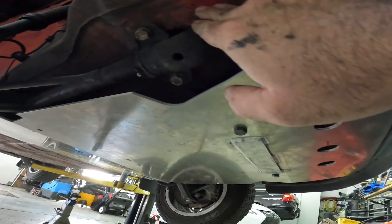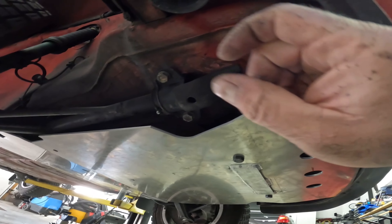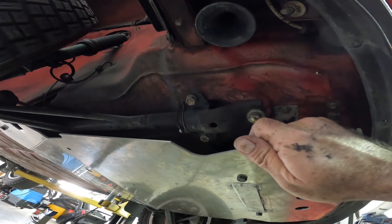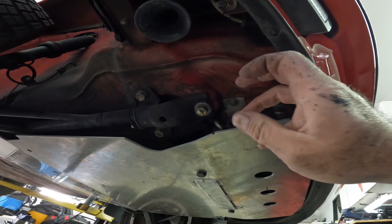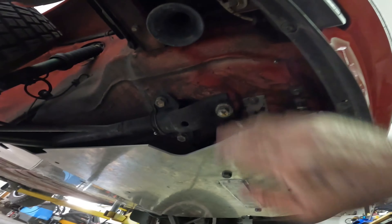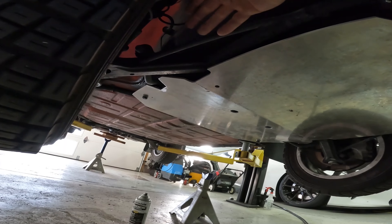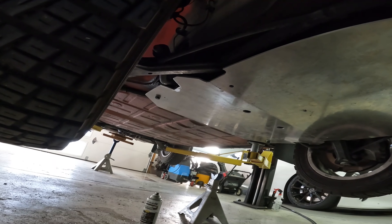It's nerve-wracking to do because you have to grind off all of this insulation and seam sealer in order to get bare metal, and then you have to weld. The other issue is the body is thin and these mounts are thick, so it's really easy to burn through the body. The only way to do this is to focus on the thick part of the metal first and jog over to the thin stuff briefly enough to make sure the weld gets on there and holds tight. It's also sketchy to weld on bodies because there's another side, and in this case thankfully the interior is not there — there's no carpet. Had it been in place, I can guarantee the carpet probably would have caught fire.